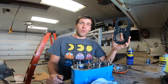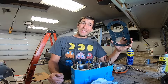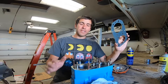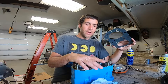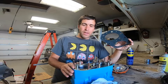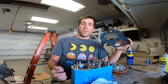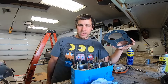I actually could be getting myself in a whole lot of trouble here. Based on how much play I seem to have in the bottom end bearings, if I only have 30 thousandths, then I could get into a situation where my pistons actually start hitting my head. What I'm going to do is put the head on the cylinder, torque everything down, then put the cylinder back on the engine dry without any sealant. I'll check my squish and if it's reasonable, I'll take it back apart, put some sealant on there, and put it back together. If the squish is too small, I may have to make a base gasket.